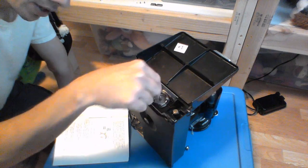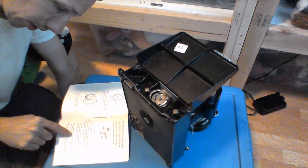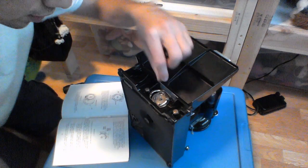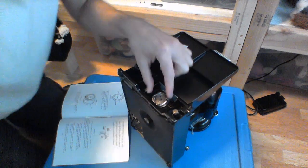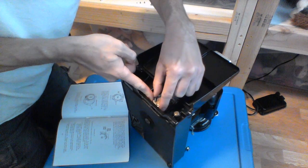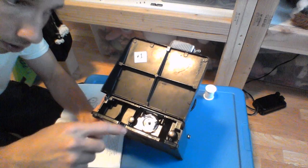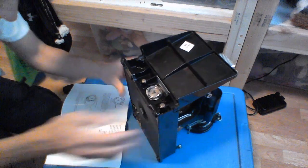That's the bobbin case base for future reference right there. Now pivot the retainer, the jib or gib, however you say it, I'm not sure, upward to the original location. The small hole in the retainer must align with the screw hole below it. So that's this part here. You push it back to its original position to line the hole up. I don't know if you can see that perfectly, but now the hole is lined up with the hole below it.